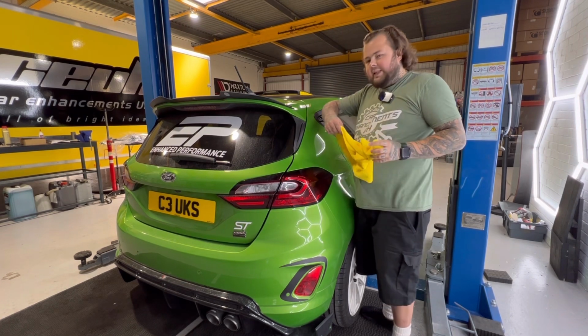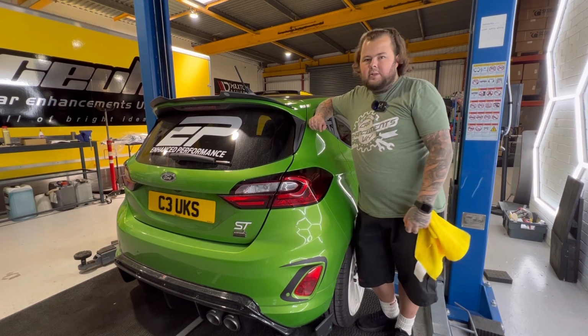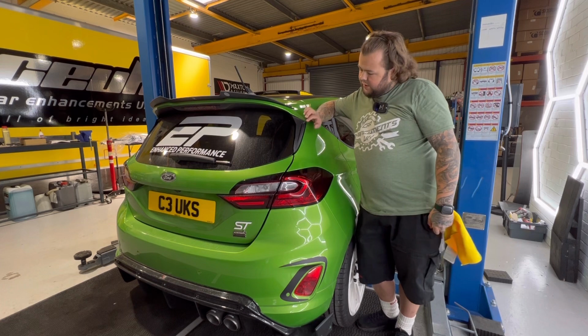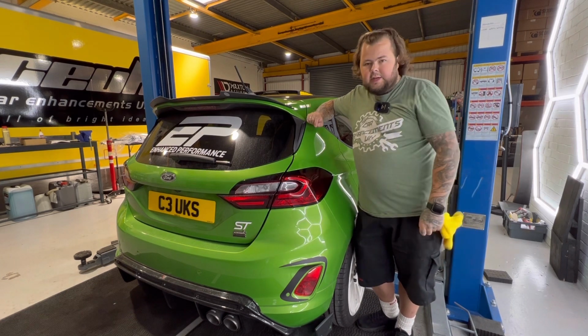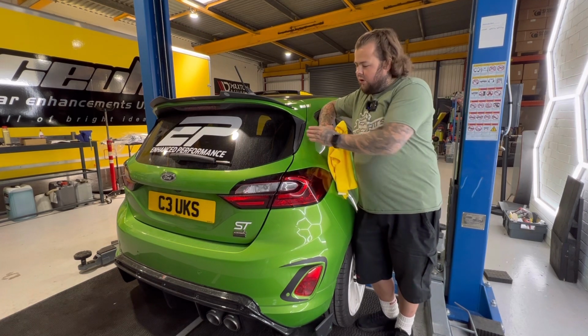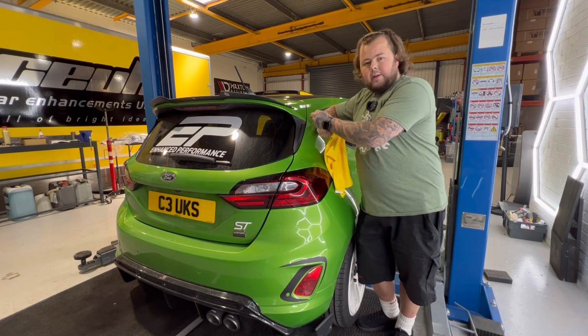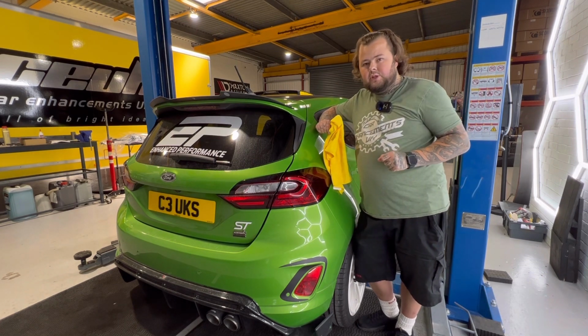So if you're doing this in the height of winter, now I'm filming this in the middle of July, it's quite warm outside. If you're doing this in the height of winter, this will be cold, and the part that you're sticking on will be cold, and so will the tape, and it probably won't form a bond. What you can do, if you wanna get a stronger bond, is get a hairdryer or a heat gun, and just put a little bit of heat on there and on the tape before you attach it.